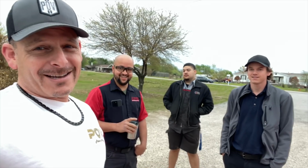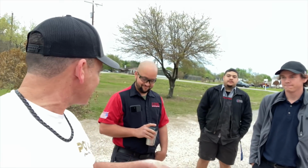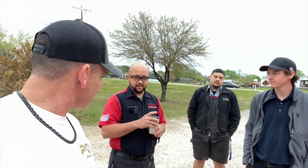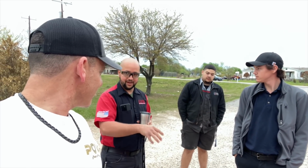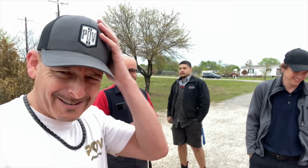Yeah, absolutely. A little bit of drama behind the scenes, but you dug into the system a little further, got into that solenoid, found a clip that was missing off of it, and you had to actually create a clip, didn't you? Yeah, I ended up using another clip from a less important sensor that's not going to trigger any light on, and I made a clip for that one and reused it on the main one. Reset all the codes, got my airbags back, that relay was bad. Fried the relay. No wonder. Anyway, that's all fixed.